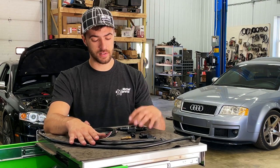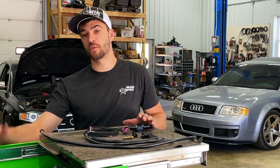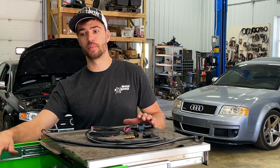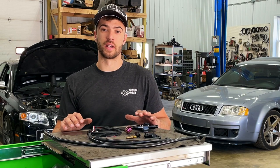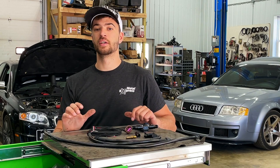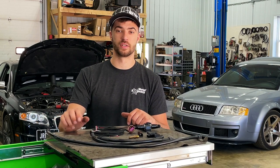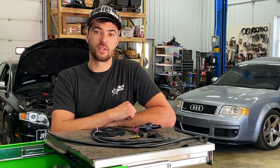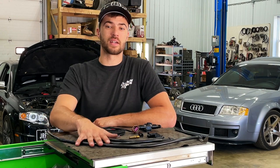They send out the lines, fittings, the sensor, as well as the wiring pigtail. I unfortunately already recorded this video, did the pump install, and lost all the videos, so we're backtracking a little bit. Luckily I didn't realize it before I had everything done, so I pulled the lines back off, and I will be tearing down a parts pump I had to show you how that gets rebuilt. We just won't be able to put the new plungers in since they're already in the new pumps on the car. But let's tear down the pump so I can show you guys how the plunger goes in, how the pumps come apart, and then we'll come back and start installing the line kits.